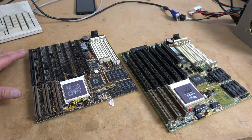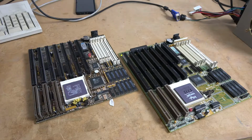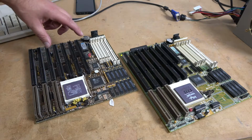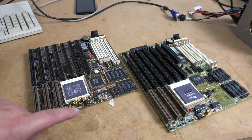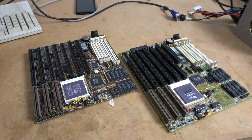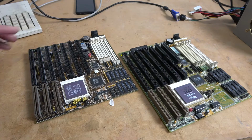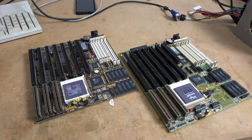which is something that I really like about 486 boards, is that they were the only ones that came with the VL bus. But later editions of the 486, which really supported more of the AMD processors, came with PCI slots. Intel, of course, was moving towards the Pentium, which was socket 5, and all the Pentium boards came with PCI slots on them. And they didn't release much in terms of 486 beyond the 100 megahertz over here, although I believe there was a 120 megahertz.